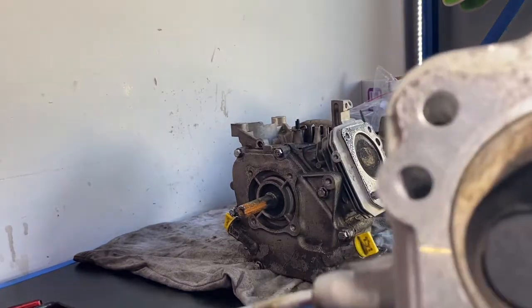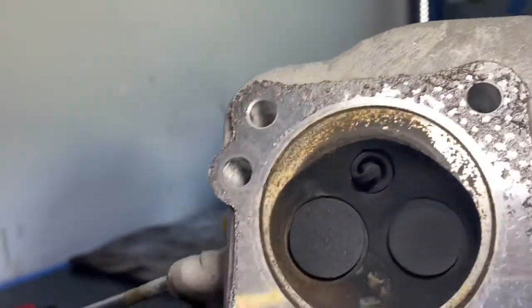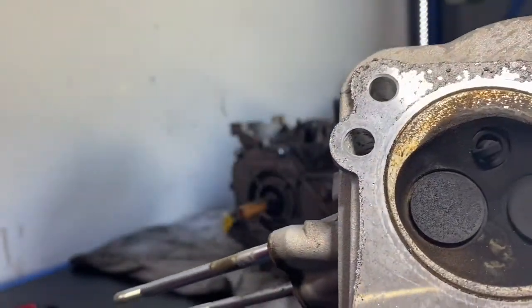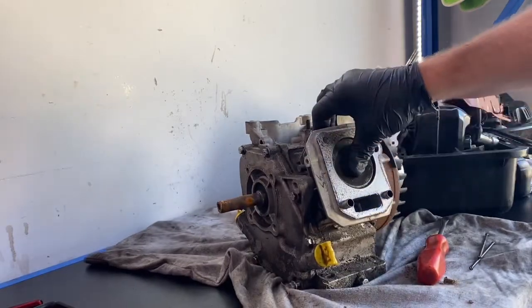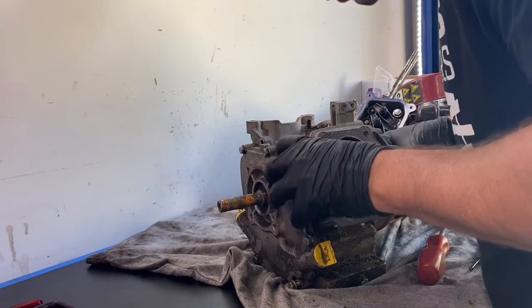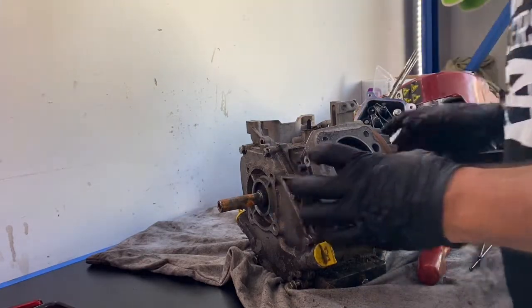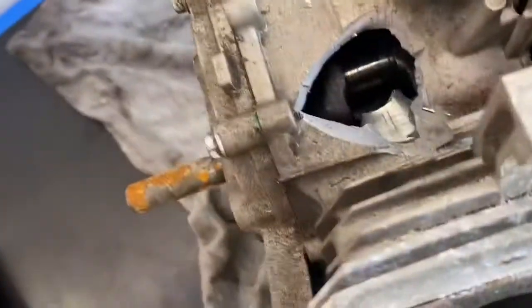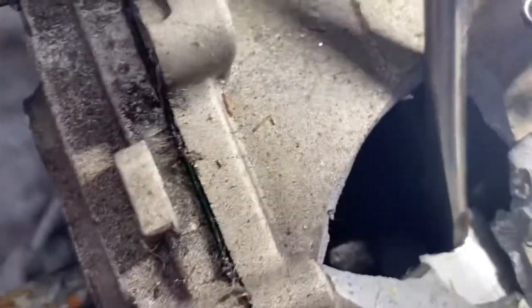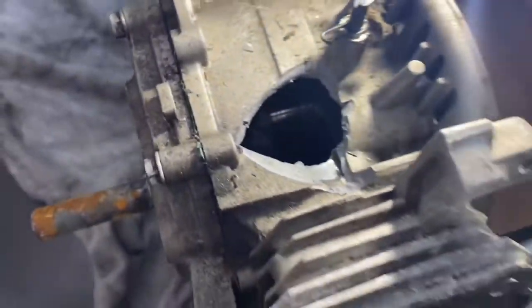Here's the head off — there's no damage up top to the valves at all, so that looks okay. The piston isn't moving up and down, though it does when you push it. So there's the culprit. I'll bring you in close and have a look now. As I push that piston back, it's not connected to anything. There's this shiny part just in there — that's your piston, that's what moves up and down. It looks like it's having a catastrophic failure by the looks. So I'm going to pull it out and have a look at it.